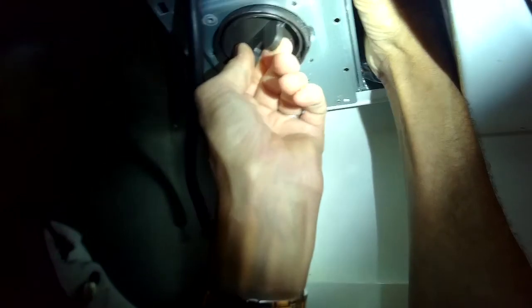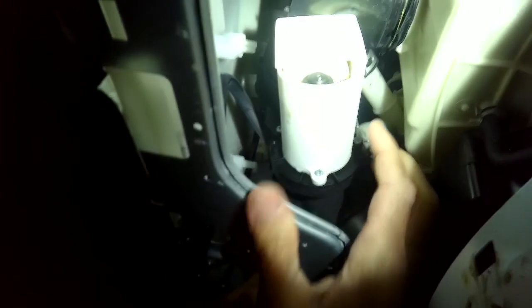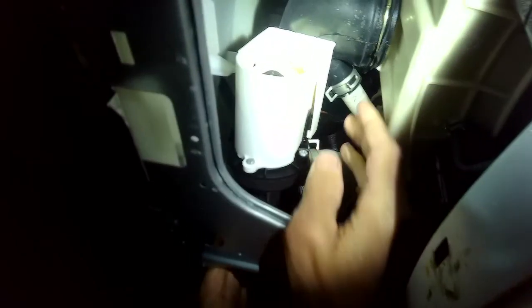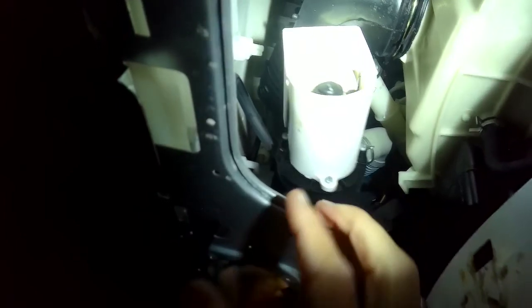One thing that's unusual about the pump: if you look at the motor, it's angled at about a 45-degree angle going upward, so when we put the new pump motor on we have to make sure it goes on at that same angle. Lifting it up, you can see the white covering on the pump motor is pointing up toward 45 degrees — like about 10 o'clock on a clock face. We have to make sure the new motor goes on the same way. Here are the three Phillips head screws we need to remove: one there, one at the top, and one at the bottom. You need a long Phillips head screwdriver to get in there because it has to clear the pump motor.